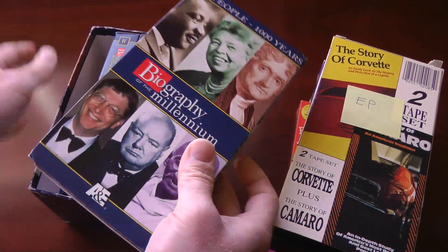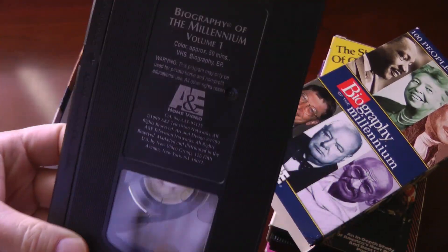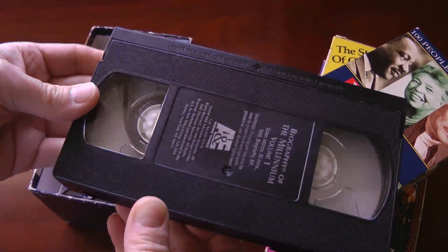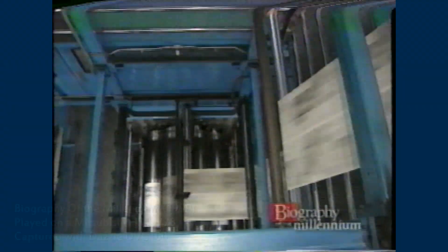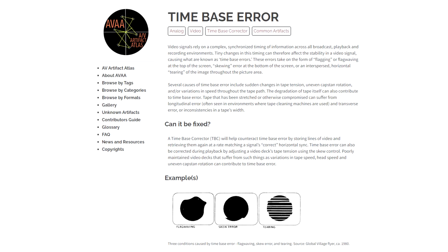Instead, they put it onto four cassettes, and each one is recorded in the lowest EP mode with as little tape as they could get away with. They didn't even use large hubs to reduce the strain on the VCR mechanism. This is not two guys dubbing tapes in a garage — this is A&E, a respectable label, for crying out loud. No wonder that when played on a regular VCR, these tapes show excessive skewing or hooking. The TBC built into this VCR would have helped with hooking, but I cannot play these EP tapes on this machine.